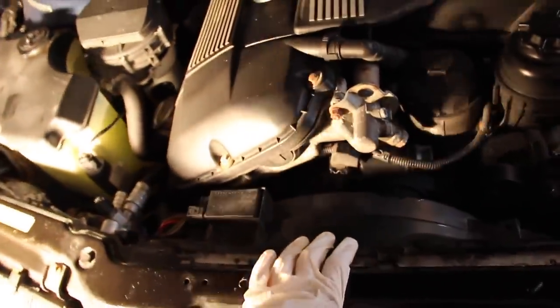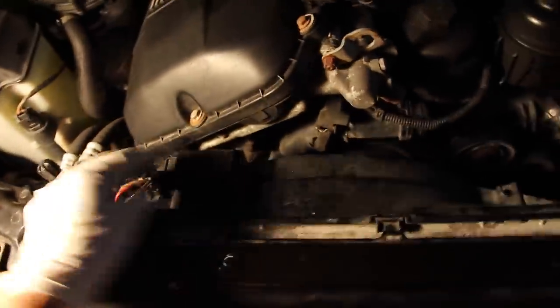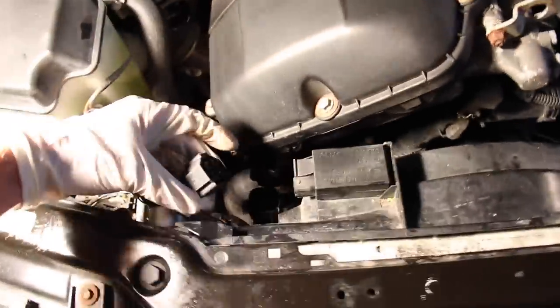For the fan, I found a T25 bolt holding in the upper passenger corner versus a pop rivet on the other side. Then there's this connector — I just unplugged the wire. The fan itself has a big connector with pinches on the side — comes off right like that. It looks like the wires sit in a bit of a clip — you'll have to work the wires out around that. Two pieces of fastening hardware, two wiring harnesses — that's your entire electronic fan. Now might be a good time to just wipe that down and make your car lighter and faster.